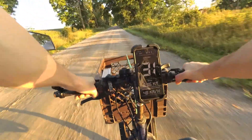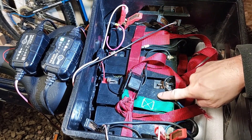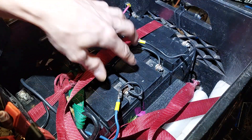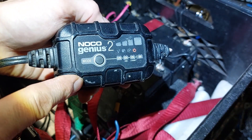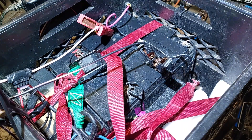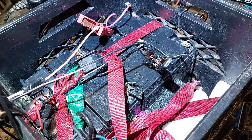I get about 40 kilometers on the batteries without pedaling. These sealed lead acid batteries are not always truly maintenance free. I have four 22 amp hour SLA batteries in series for 48 volts — quite heavy, but they provide a good range. I use pulse chargers; I charge them individually in the AGM setting since these are glass mat type batteries. Sometimes I use a 48 volt e-bike charger, but charging them individually with a pulse charger gives them a nice deep charge.